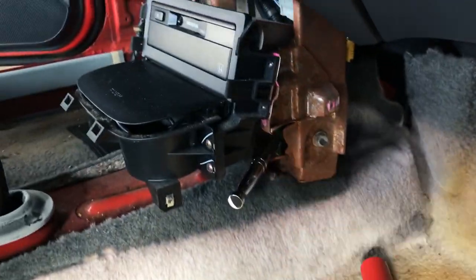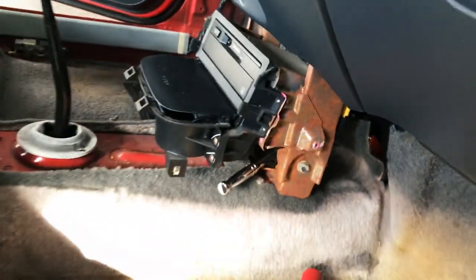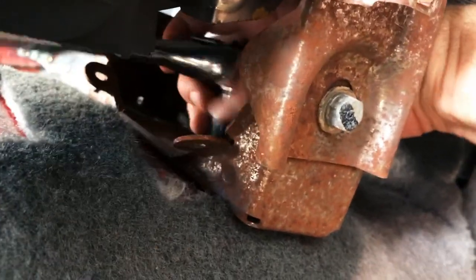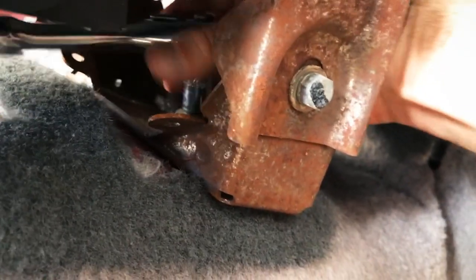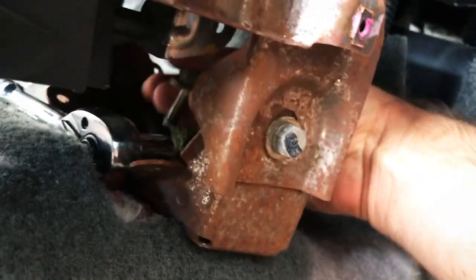One thing I'm doing here is taking out the bolts from underneath this piece. So I already got one out from the inside, and there's another one on the other side just like that. The carpet is connected there and there, and I don't want to cut that big of sections. So I'm taking this bottom little piece out and hopefully sliding the carpet out underneath it. I kind of just broke this thing free using my red breaker bar, then just got my hand in behind here to ratchet the bolt off. It is a bit awkward and challenging, but I just got it.